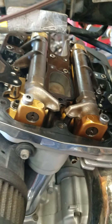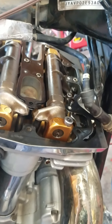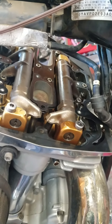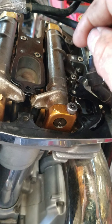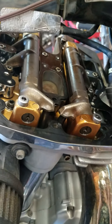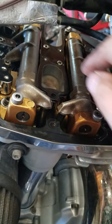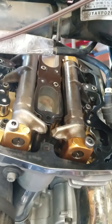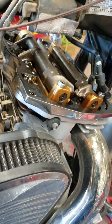Then by bumping it over you can verify yourself. Take your time. Monkey with it enough until you get the feel of what's going on and what it's doing, and you'll teach yourself the feeling of when it's tight and when it's not. Leave the spark plugs in it, because that way you don't drop a valve cover screw down in the piston hole and go fishing for the rest of your life, wishing that you had a horse instead of a motorcycle.